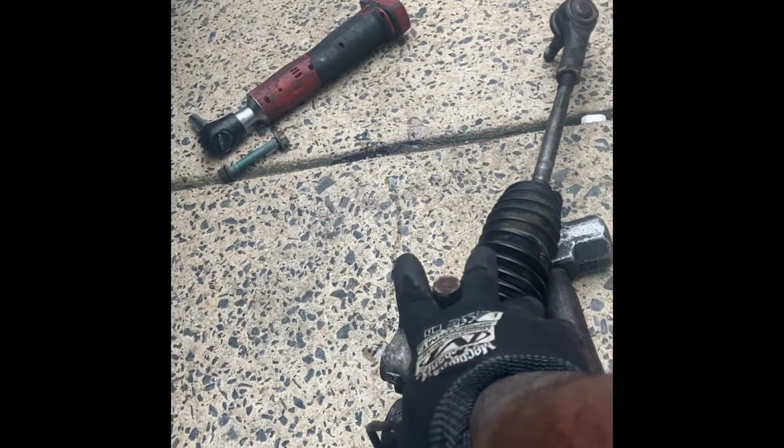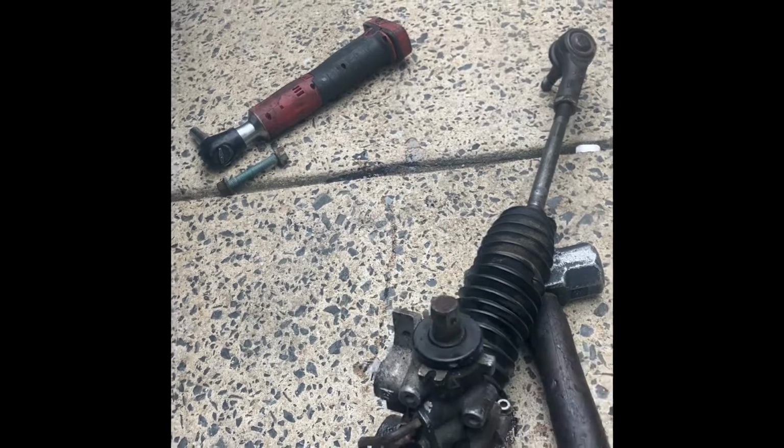And then you want to take a trusty dusty pry bar. Give me a second. And you want to pry right here, and we pry down here. That gives it enough clearance for the steering knuckle shaft, for the shaft connector, whatever you want to call it. It gives enough room to clear this. Once it clears, it pulls right out. This technically can be done in about maybe 3 hours if you know what you're doing.